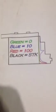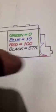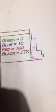The next step is to modify your fuel plate. This tooth right here is what we modify. Here's a chart of the ways you can modify it. You can't really do the blue one because that material doesn't exist there unless you weld it on. You basically have two options: you can do the red one, or you can do a zero plate — green being the zero. With a zero plate, you basically just cut this tooth off flush.